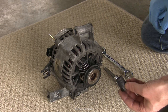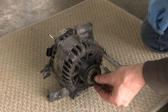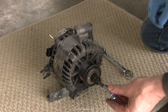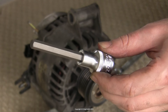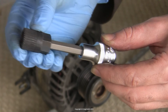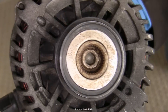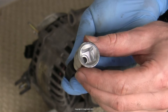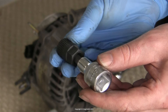The special spline tool inserts into the upper section of the pulley and is hollow, meaning you can get a bit through it to hold the shaft. In my case I needed an 8mm hex bit — a normal length one won't be long enough, so you need the long extension version. Many shafts use Torx rather than hex, which worried me initially since an 8mm hex is small and doesn't usually take much torque, but the shaft is hard steel and I had no issues. You'll need something attachable to a bar — a square drive attachment bit is typical.